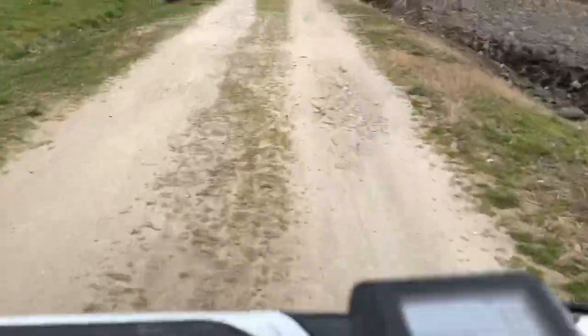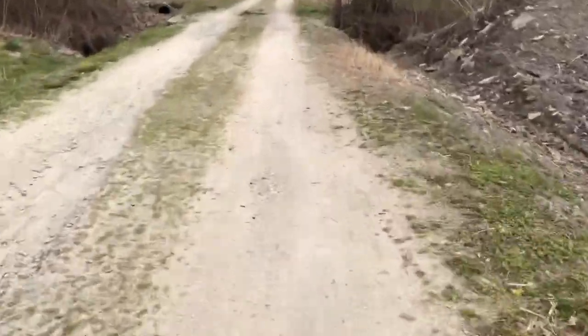A good thing about fitting bigger tires like this is that you have the possibility to increase the comfort and the grip of your ride. You can deflate them a little in case of very slippery terrain, mud or steep sections, or you can make them harder if you want to ride a bit faster on terrain like this, quite compact, so you can get some speed to keep up with your mates. It gives you much more possibility of adjusting the pressure, comfort and grip of choice.